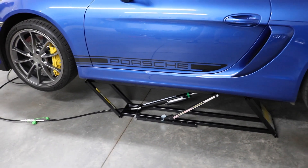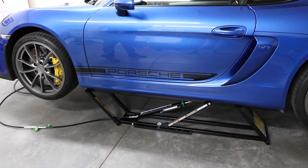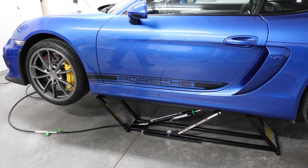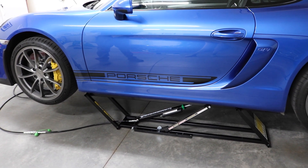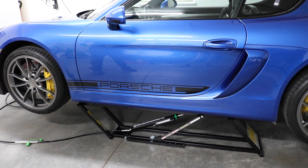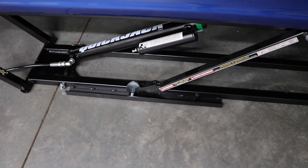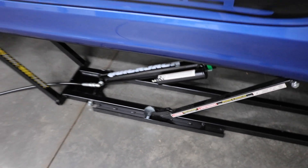We're doing this for the first time live with you guys. The instructions say: make sure all lift points are good, rock the vehicle gently — it's not moving, which means it's stable. Press up and continue raising the QuickJacks. To engage the QuickJack on the first locking position, press down and the frames lock. The last step was pressing down on the controller, which locks it into position in the locking safety mechanism.